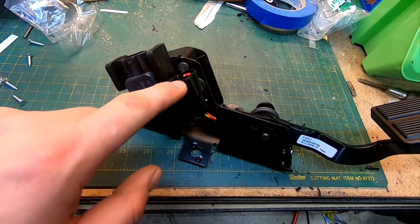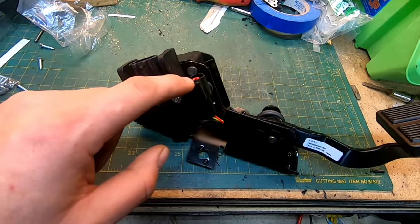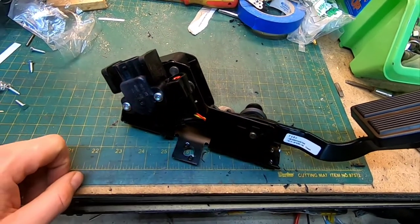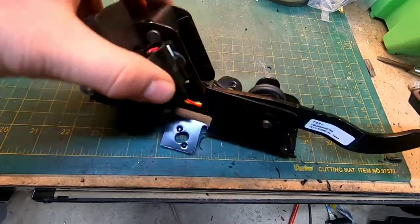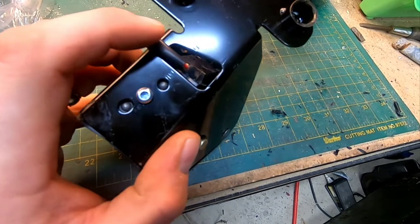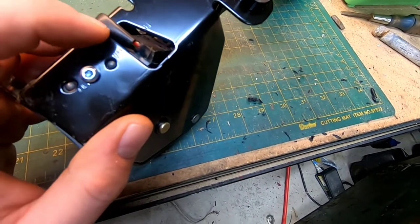This plug here is a position sensor switch, and what it does is tell the computer when the pedal is all the way up to go into idle. When this switch fails — which it also started doing on my truck — you will be sitting at a stoplight or in park in your driveway, the truck will be running, you'll press the pedal, and nothing will happen. It will not rev up; the truck will not move. It just stays in idle. That switch is kind of cheesy — surprised Ford would do this — but it's right here and it's glued in, not screwed in place. I've read that sometimes they just come loose and fall out. Sometimes the switch just gets old, like in my case, and just doesn't activate all the way. I don't think you can replace it individually, though I could be wrong.